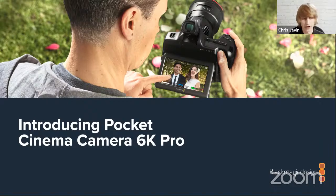The NDs operate via a new slide system, so the controls are positioned on the rear of the camera and use a plus and minus button. They range from clear to a 2, a 4 and a 6 stop ND. Creatively, the NDs feature infrared glass and have been specifically color balanced to match our sensor, allowing the creator to use the NDs without any worry of aesthetic changes to their production. You have the option to alter your depth of field whilst maintaining an acceptable amount of light and without the hassle of adding additional accessories.